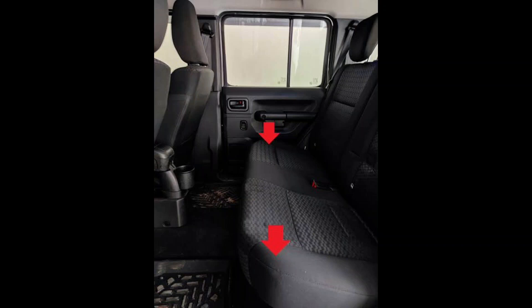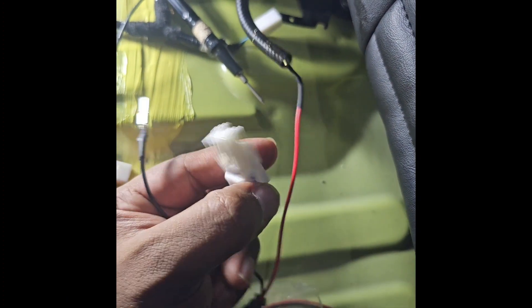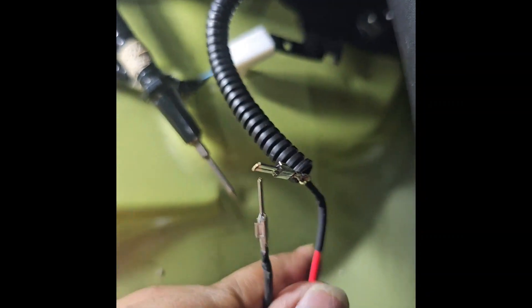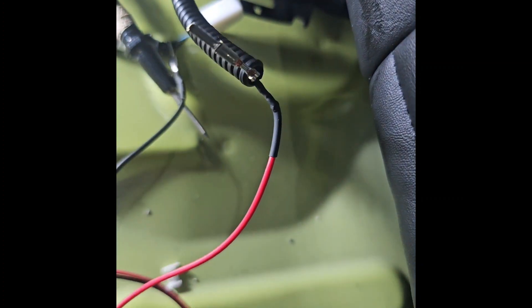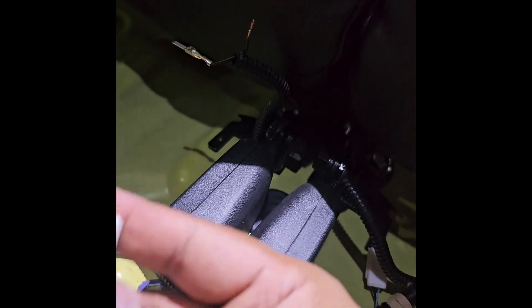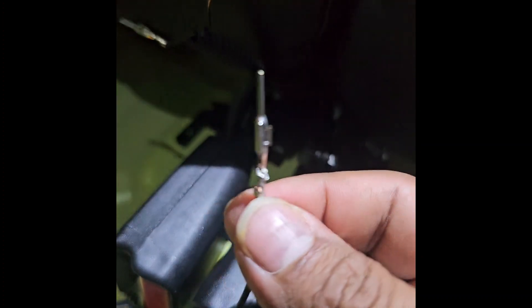This will help overcome the issue at hand. Push up the seats at both corners and remove two bolts at the rear, and you will find the seatbelt wiring circuit below. Basically what I have done is remove the coupler pins — two pins within the coupler — and this coming into this coupler. I have removed the two-pin connector from the socket, detached one of the connectors from the wire, and added an extra wire to that.